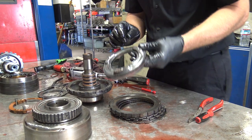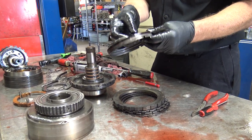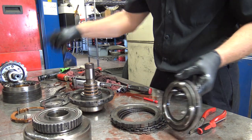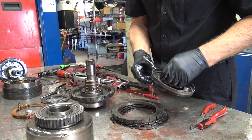Some other ones will have three seals — you've got to look. Oh my gosh, that's hard — it's splitting. See how it's splitting? That means it's hard. So there's a combination of problems besides that apply piston. These seals come in a kit.